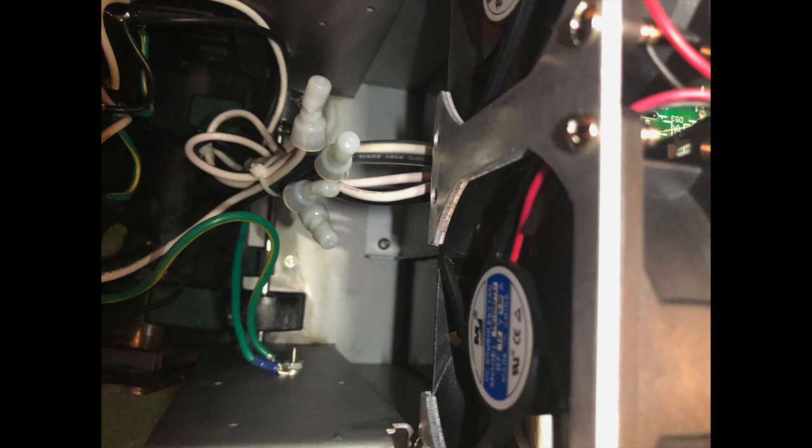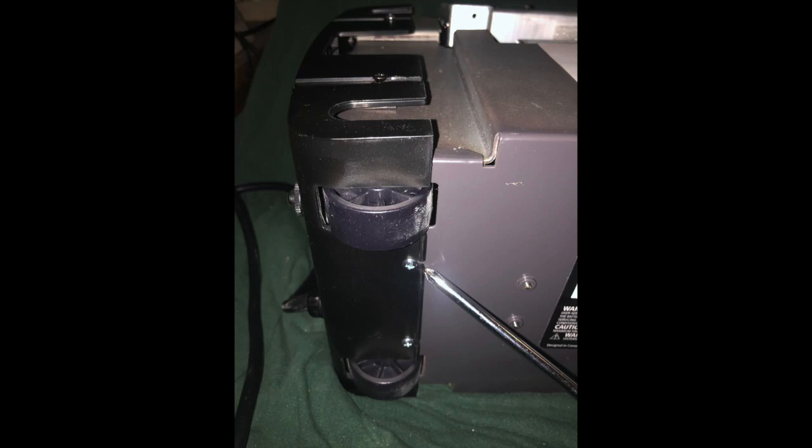Next are the front and rear panels. I put the rear panel on first — putting the two green wires back on the nut and bolt that holds them, then sliding it into place. Start by half-tightening all the screws and bolts, because you have to get the front panel, rear panel, and top pretty much aligned before you tighten them down. Some of the fasteners are on the bottom, so you've got to tip it over and have it all held together at the same time. It's time-consuming and tedious, but not a big deal.